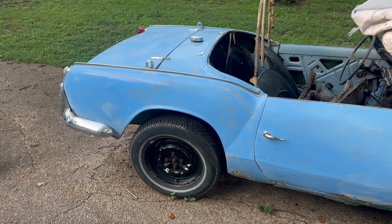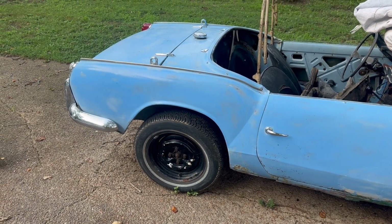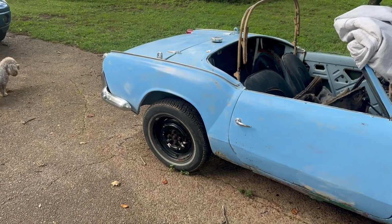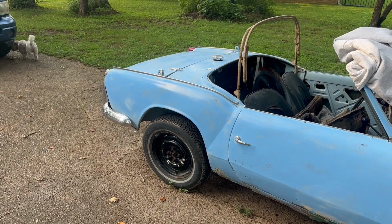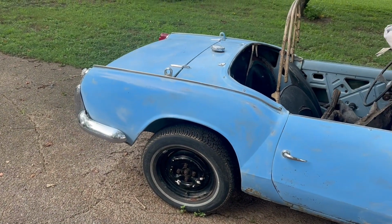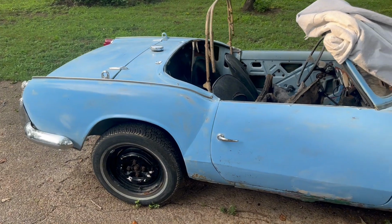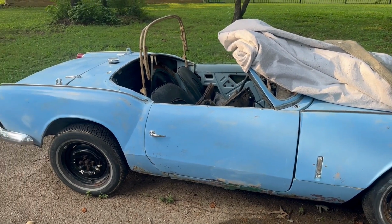I thought I had ordered the Freelander studs off of Amazon, of all places. They were actually really well priced. And then when I went back in there, it only showed one available, even though there were 3 when I thought I placed the order. So I may check on that tonight and reorder those if they show back up. But in the meantime, locally I bought the Dorman 610 440s, which other people have used, except they don't have the beveled inside edge on the head, which there's ways around. So we'll figure that out.